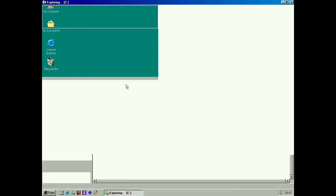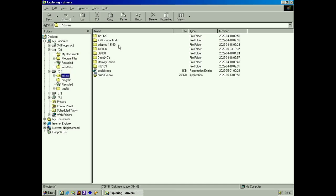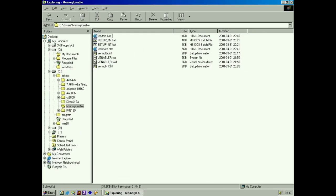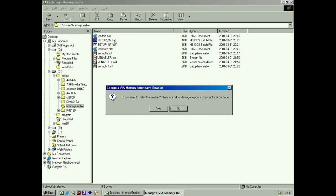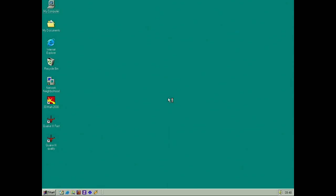I'm going to install a program to enable memory interleaving. Some boards have that in the BIOS but this one does not. I installed DirectX 7, Nvidia 7.76 drivers, and VIA 4-in-1 4.26. We're going to use Memory Enabler Setup 9X — this will basically enable memory interleaving 4-way. Back in Windows after restart. I'm doing 135.8 now, so not a huge improvement here — about one frame. But in memory benchmarks I see about 10% more memory bandwidth.